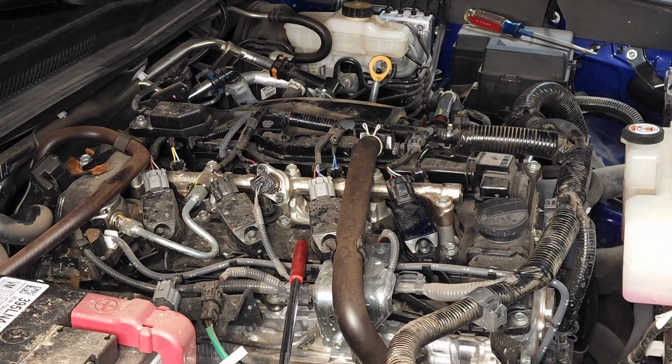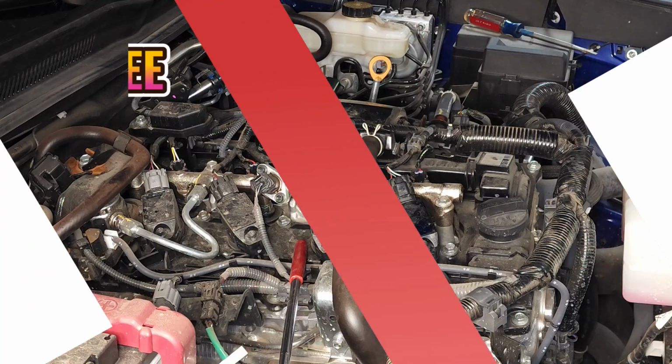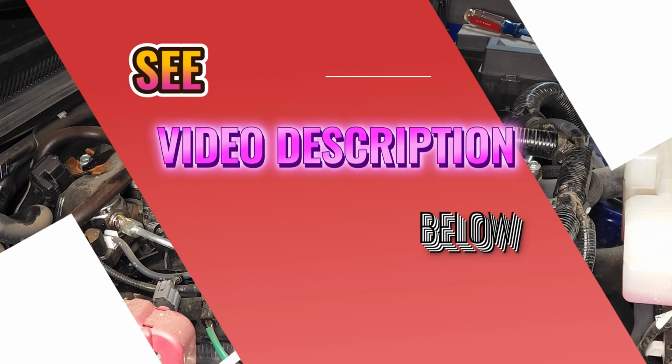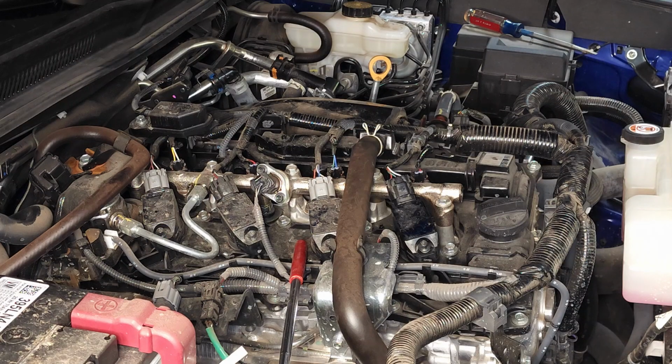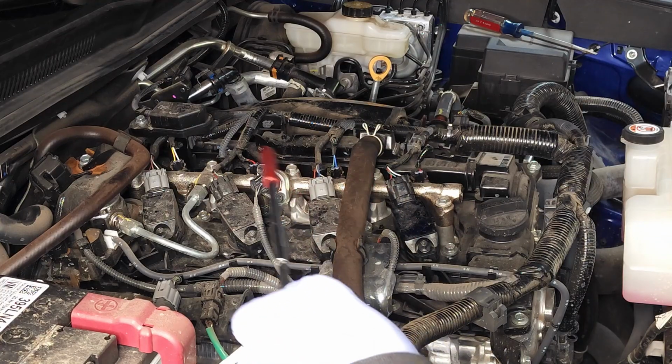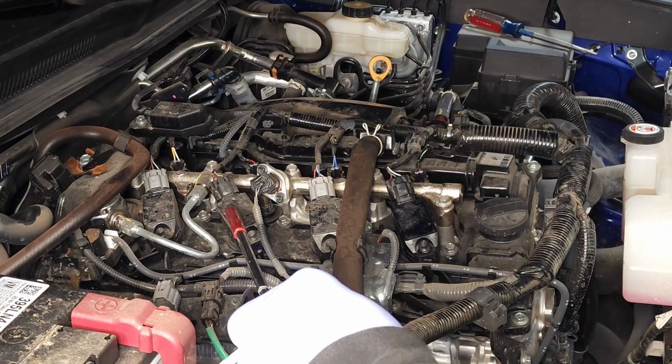Our supply list includes a 9/16" thin-walled deep socket, a ratchet, an 8mm socket with ratchet, and some dielectric grease. Please see other items in the description below. So let's go ahead and move forward with the removal of the coil and spark plug at this location. All other coils and spark plugs can be removed and replaced in a similar manner.